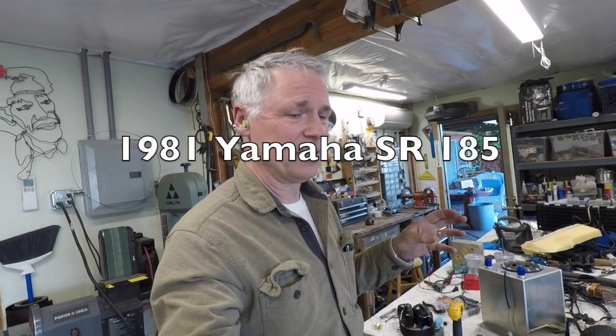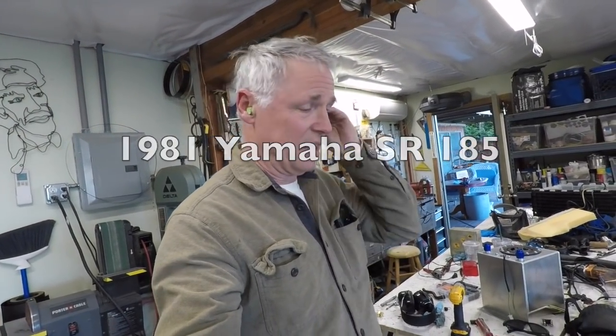This being a beginner's bike, I realized after searching the internet that these came with a lot of safety features. And one was a little off switch on the kickstand, and I had one plug dangling there, and I realized that was it. Cross the wires, boom, started up. Pushed a little harder for the clutch. Clutch is now working. It's all A-OK, and it's a fun ride.